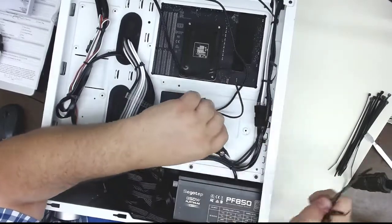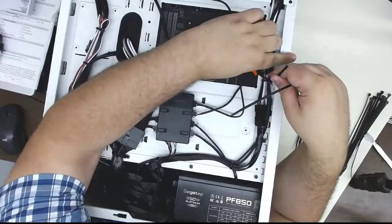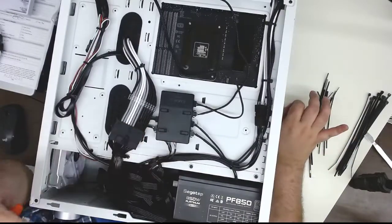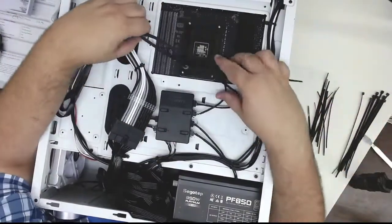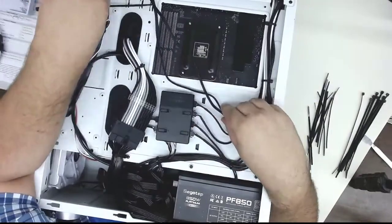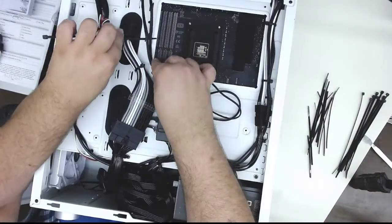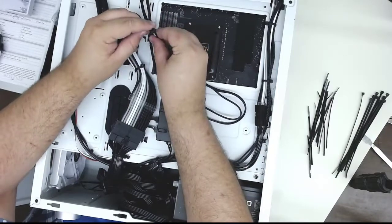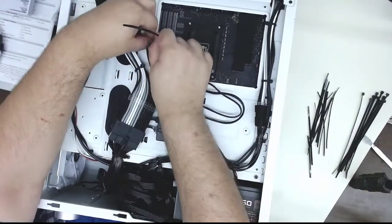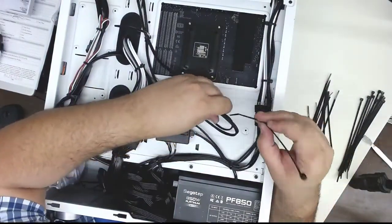I mean, the 1660 is still a great graphics card. It's not the best one, but in terms of that last generation, GTX versus RTX, if you're doing lower-end gaming or basic stuff like watching YouTube, as basically a higher-end office computer, the 1660 is a great graphics card. If you're trying to get into bigger gaming, I definitely would recommend upgrading to at least a 2060, or if you can get your hands on one, a 3050. But if you're not doing anything more than watching movies and maybe some light gaming, that's perfect.